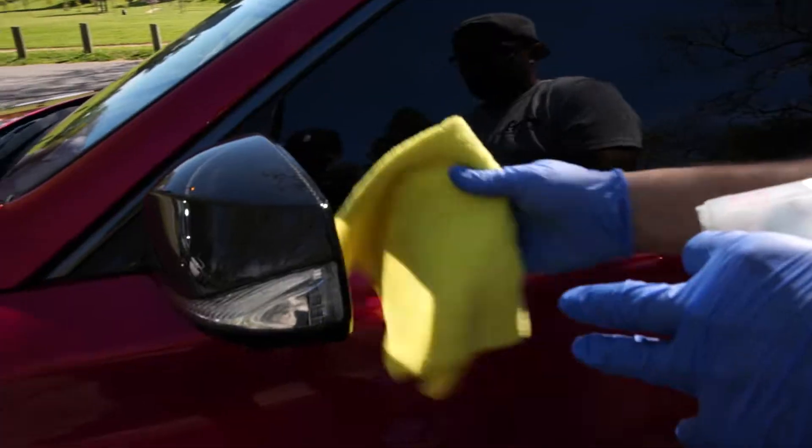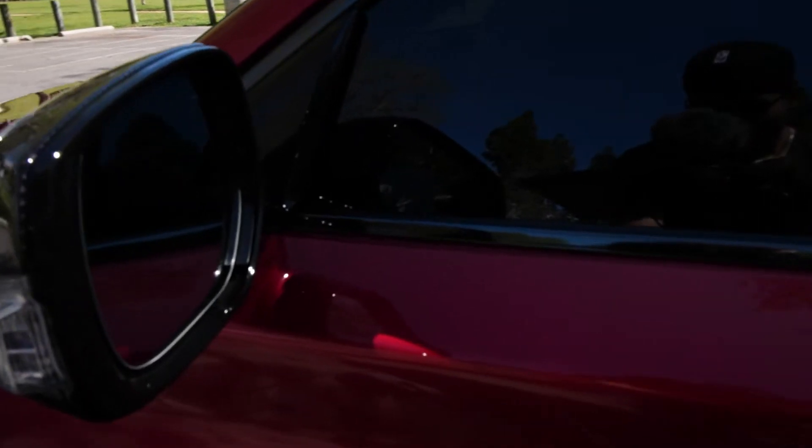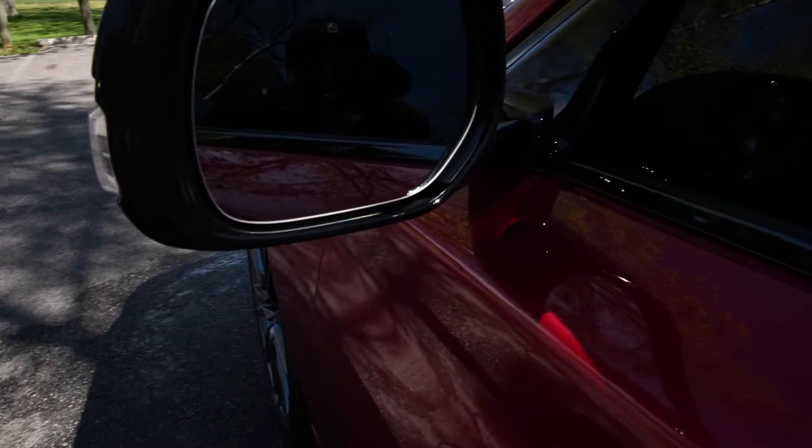What kind of rag do you use for the ceramic detailer? We always use microfiber. Because if you don't use soft microfiber towels, you can end up scratching the paint or damaging the inside — whether it's the leather or the vinyl. We do not want to damage any car. So for the whole car, even the windows, it's microfiber. But we use clean window towels kept separate, and the interior ones are color-coded — black, green, blue — so we know which one to use.